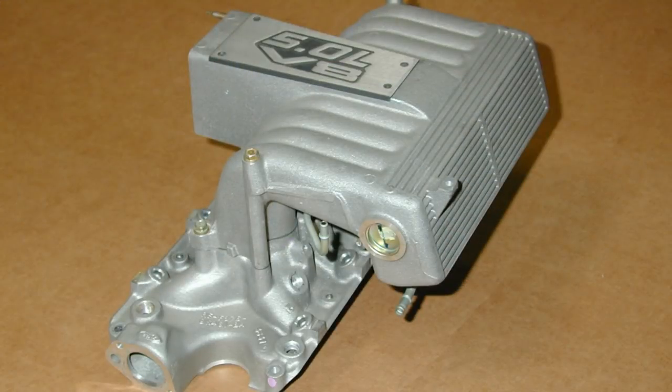The takeaway from this — it is possible to crown a winner, but I would crown it from a different criteria than most. In this one, it's bang for the buck, and I do have to say the Explorer manifold is the best bang for the buck currently. The Cobra manifolds are no longer offered by Ford Racing or Ford Motorsport and they're becoming less common, whereas the GT40 manifold never saw a huge circulation to begin with, and those two are going up in price. If you want absolute bang for the buck, grab that Explorer piece, clean it up, put some rattle can paint on it, and go to the races. If you want something that has a cool Cobra look, grab that Cobra piece — or if you're doing a restoration, that's the one to get. And finally, if you want a piece of underhood art that performs pretty well but you want to pay the premium for it, grab that GT40 manifold. Incidentally, if you have a GT40 intake manifold sitting around not doing anything, drop me a line — I'm kind of looking for one for the wall. They're a really nice display piece, if nothing else.